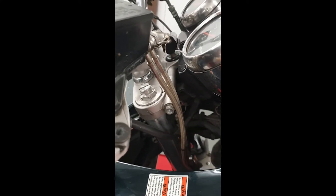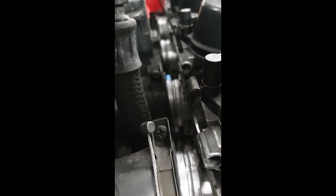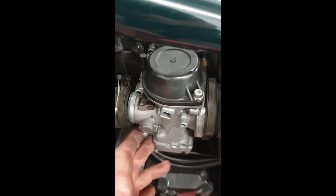Don't try and take the cables off the carbs because it'd just be a nightmare. The easiest way is to take the cables off the throttle and take the cables out — a bit fiddly but you can squeeze them out. The choke cable on this side needs to come off too; pull it and fiddle around getting it out of the holder. A little awkward but get some long pliers and work it round. There's just enough room to clear the carbs, so you have to squeeze them out the side.